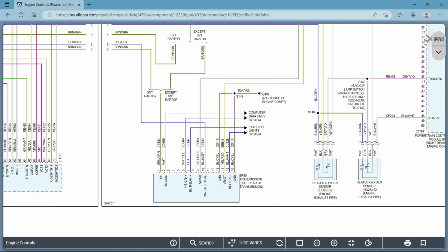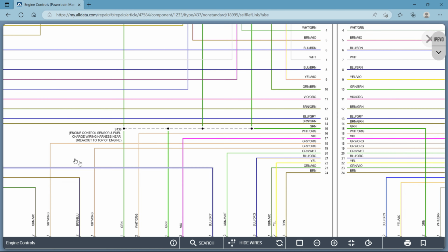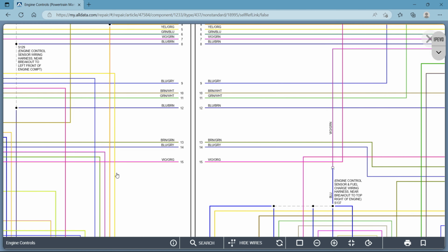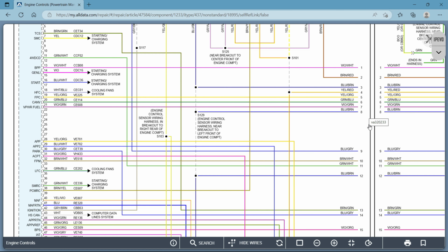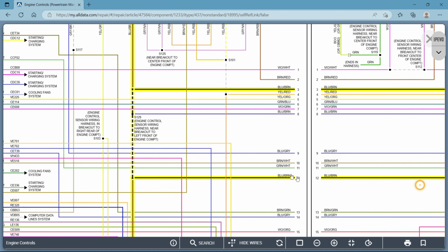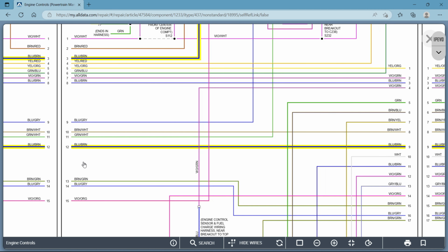And then the last thing that I didn't talk about at all, which this is a very good diagram for it. This is, I believe, a 5-page wiring diagram. But what I want to talk about is the numbers on the side of the page. What that corresponds to is if you want to try to follow this circuit, this blue and brown circuit, this is page number 1. So any page is going to be after that, which the way we read in the States goes from left to right, okay? So if you look at the right side of the page, you'll see a number, 12. Well, when you go to the second page, remember I just said we in the States want to read from left to right. So on the left side of the page, you'd pick up number 12.